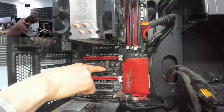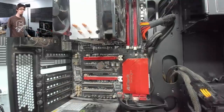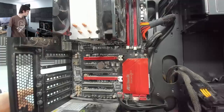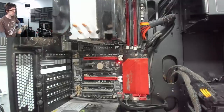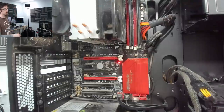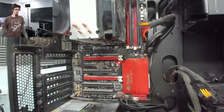I've moved this jumper over to the other side, which should select the backup BIOS. Let's turn on and see if it boots from that. There you go — the light has moved across, so the BIOS select has worked. Still nothing.